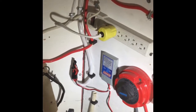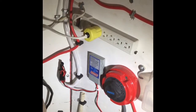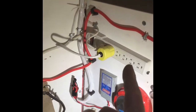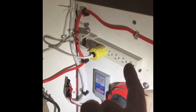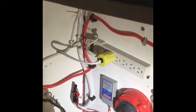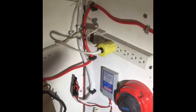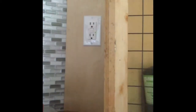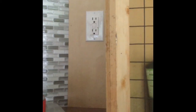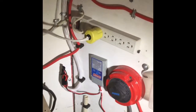The 1500-watt inverter runs our coffee machine no problem. Coming out, it goes into the surge protector or outlet box. If I want to go to shore power or 110, I can just plug that up and then all the plugs are on 110 from an extension cord. That goes up to this GFI, which is the breaker for the trailer. The outlet box is right there.